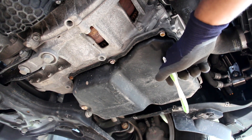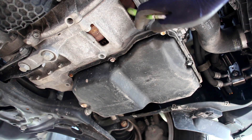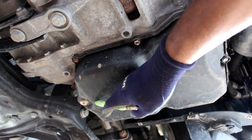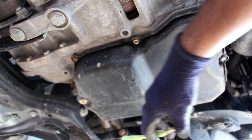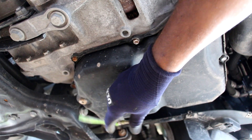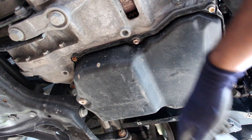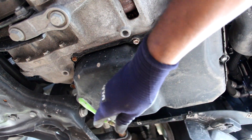Here's a look at that starter motor from down below. Taking a look underneath the transmission we have a plastic oil pan. The bell housing has these little holes where you can see the torque converter — not sure if that's good to expose to the elements or better to have it ventilated. Replacing transmission fluid on the Tiguan is quite a mission because there's a drain and fill port located down here. Once you take this plug out you've got to take out a straw and the transmission fluid drains out. Then you've got to hook up a special machine that screws in and pumps fluid from the bottom up inside the transmission pan. When it's full you plug it back up — it's a very unintuitive design because you're pumping against gravity.